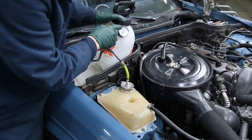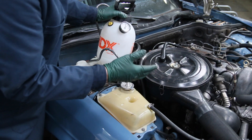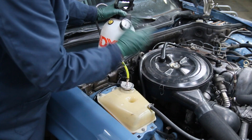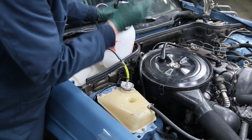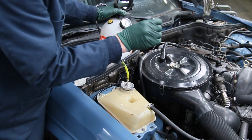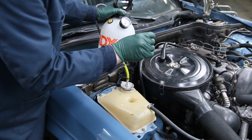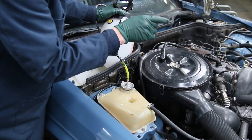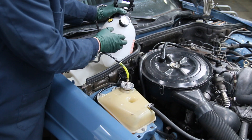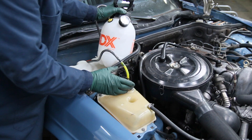It's stabilized — not moving. I do not have any coolant leaks on this car. But if you've got a mysterious leak — if you're adding coolant every couple of weeks and don't see any visible leaks — you need to do a pressure test. A lot of times these really small leaks, like a pinhole in a hose, won't show up until you're driving at high speed and high engine temperature. A pressure test like this will show those leaks right away without having to get out on the road. For those of you who already have my pressure brake bleeder, this cap adapter is ready to ship now on our website.